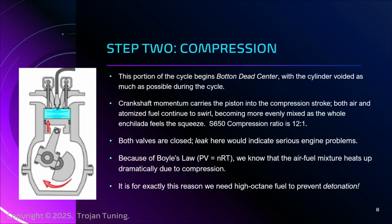But I set my targets too high, and I'm running it too hot, and my tune was done in spring, and now it's July. And also, I've done a few other things that are increasing the power that I'm asking for from the engine. If you get too hot, and then you put in fuel that isn't high enough octane, it'll hit the cylinder walls and it will ignite without the spark plug going off.